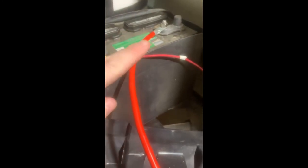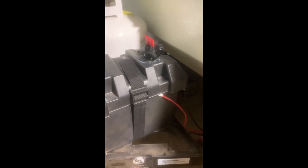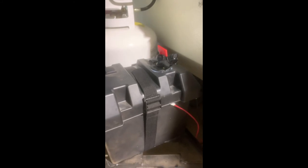I just got it all wired up. I've got the negative there on the on terminal and I've got the battery cable — I'm using a red wire just because I had it already and didn't want to buy a black one. I've got the four-gauge cable connected to the off terminal and the negative terminal on the battery. So now when I flip the switch to on, it'll connect everything and should be good to go. I've got it all back together and the key just pops right out. It's got a rubber seal and a cap, which is kind of nice. I hear the converter running and the battery's charging. Once the battery's charged up, I can turn the switch and kill the battery and then I won't hear any more chirping. Problem solved.